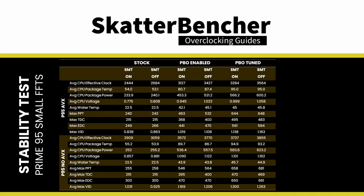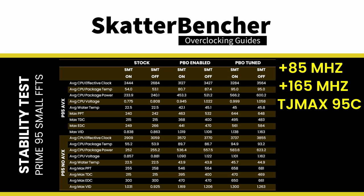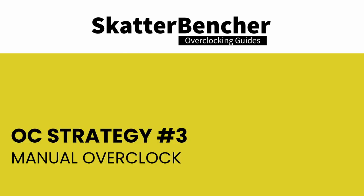It boils down to this: the tougher the workload, the more it makes sense to tune PBO parameters. In our toughest workload — Prime95 — we see the biggest gains: by manually tuning PBO, we get between 85 and 165 MHz additional frequency in sustained multi-threaded workloads. However, PPT, TDC, and EDC are no longer the limiting factor — in all scenarios we see CPU temperature close to or right on TJ Max of 95°C and water temperature at 45°C. It would certainly be interesting to see how a larger radiator or better fans would impact the maximum frequency.